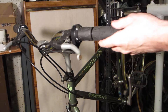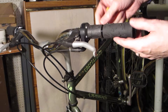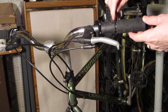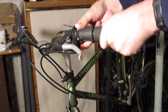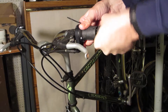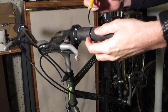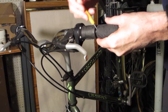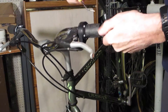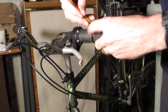I'm going to work on the grips and the grip shifters today. The first problem is this gap — we don't want a gap like that. These grips are usually on really tight, so what I do is try to get under them with a little tool to create a pocket. Be careful not to tear them up, but give them a little movement.